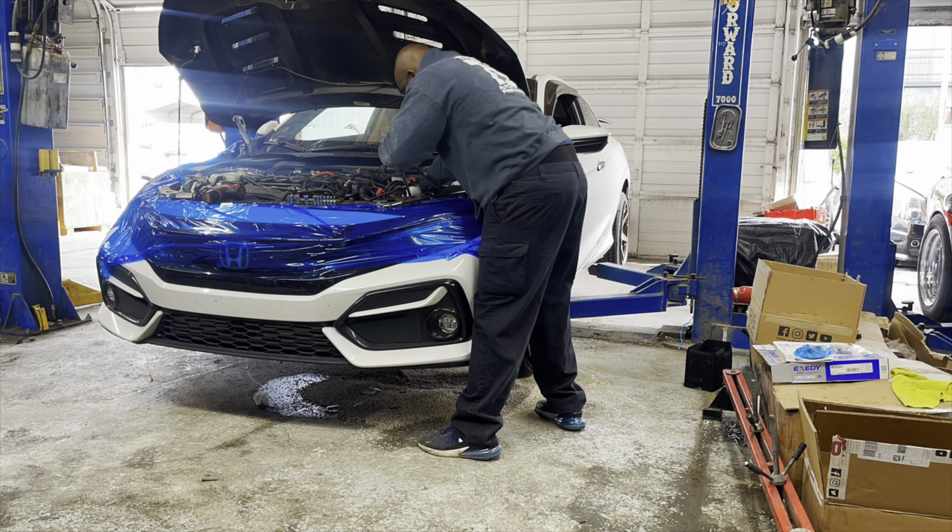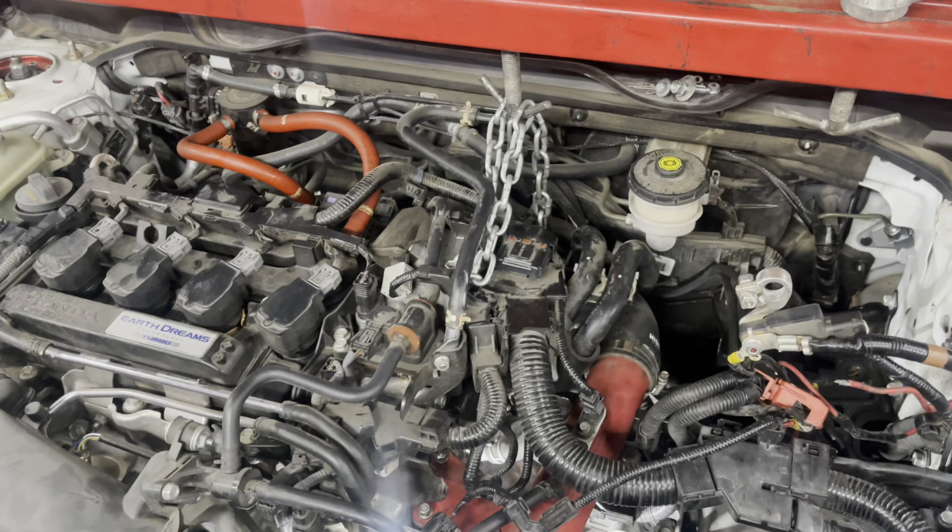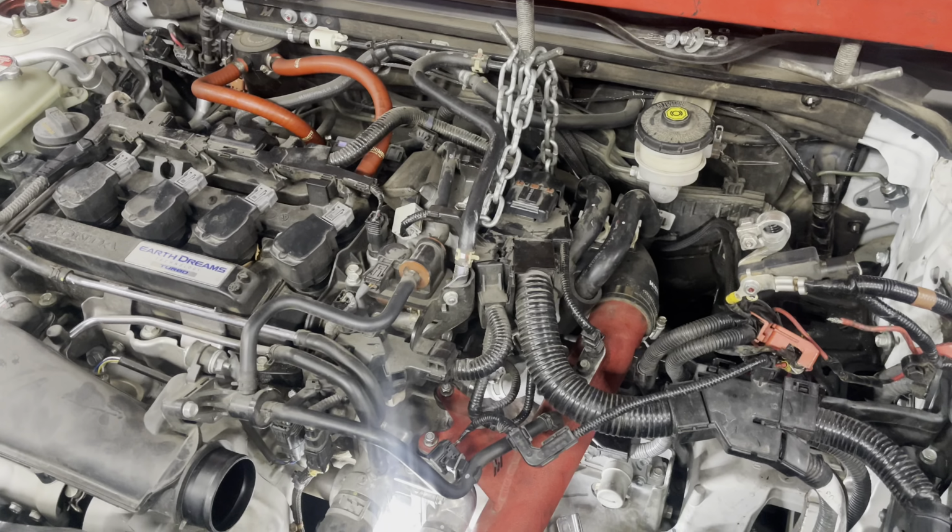So we got all the air box out, battery, shift cables out of the way. So we're gonna go ahead and get the engine braced and then start taking all the tranny bolts out, get the rest of these electrical connectors and all that off, but chipping away. Pretty much everything in this area has gotta be removed. Got a nice tie down point on the bracket there for the fuel pump. Go ahead and start getting these transmission bolts out, and then get the trans removed. Start getting that new clutch put in.